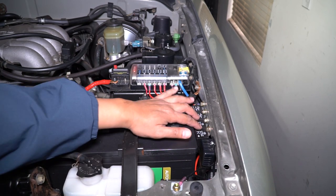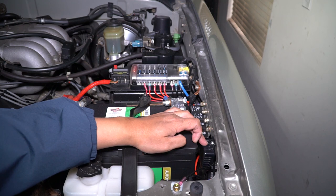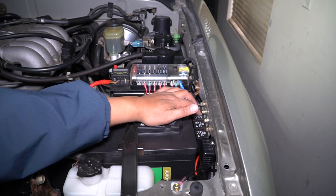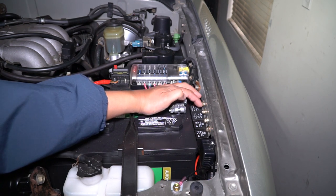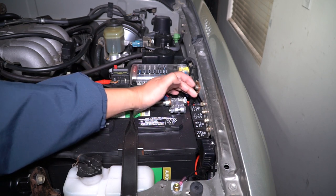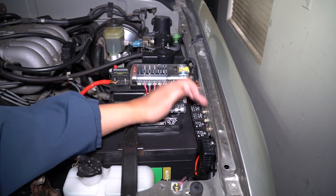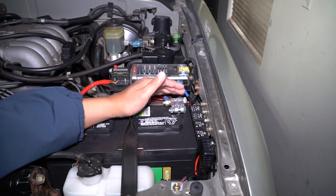Here's a slightly closer look at the relays. You can see I've got 4 relays — I think this one is for the dual light bar that I have in the back. They must be for the LEDs and light bars. The way I attached these is I took the relays, drilled out the holes a little bit larger since the holes are actually really small, and then I found some 10mm bolts — just spare ones you can find at the junkyard or take off your car.